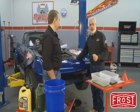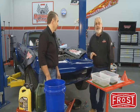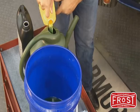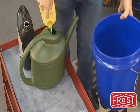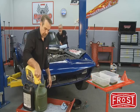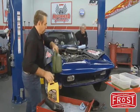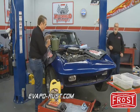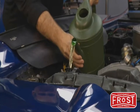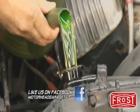We've flushed this with clean water two or three times and just drained it out. Now that we're clear, I closed the petcock and we're going to go ahead and put a 50-50 mix of antifreeze back in. Start off with a gallon of fresh water, put a gallon of antifreeze in it — now you have a 50-50 mixture, which makes sure you've got a consistent mix. We'll pour in the 50-50 mix, let it run with the pressure cap off until the thermostat opens. When the hot water flows through the top hose, we'll expel any trapped air, put the pressure cap on, and we're done.